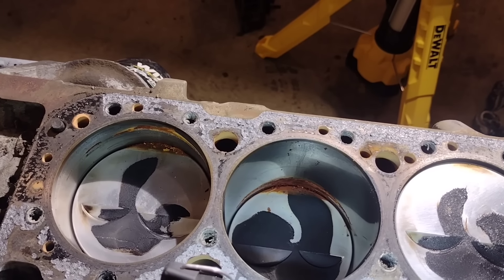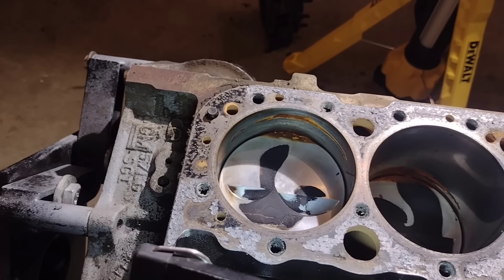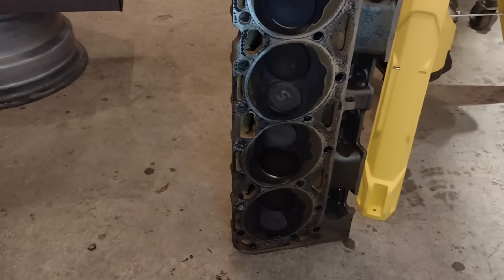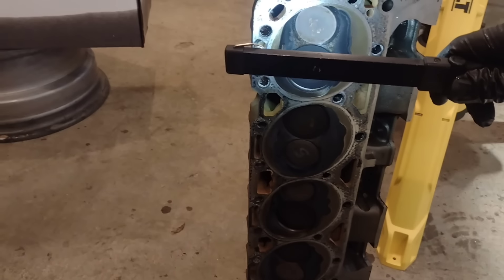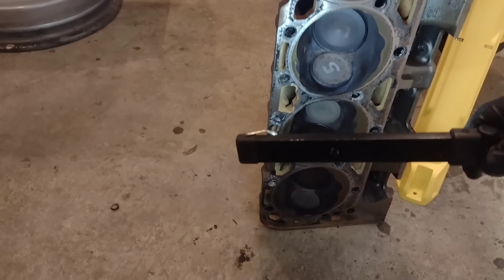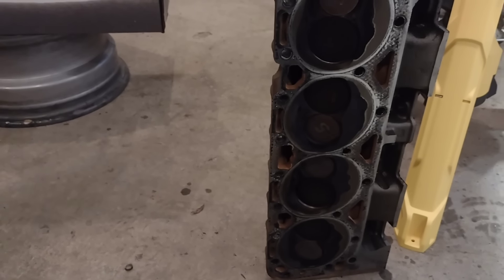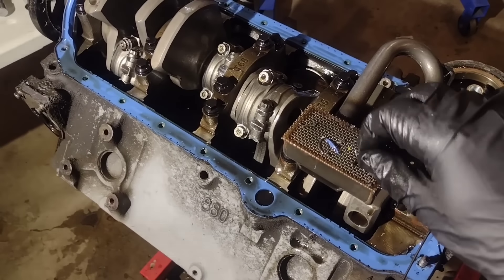Well, let me show you one of the upsides to ethanol. You may notice some carbon deposits and a little bit more rust deposits on the valves and combustion chambers, but one thing that I think is absolutely wild - if you look, you can actually still see where I labeled these valves when I was building these heads. Not on all of them, but the combustion chamber temperatures with ethanol compared to gasoline are so much lower that a paint pen actually survived 32 nights on the faces of those valves.